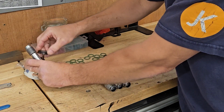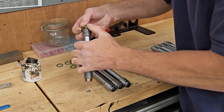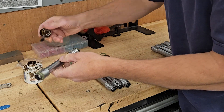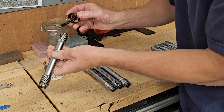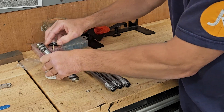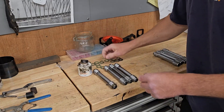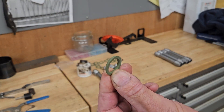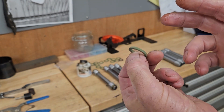First I'm going to apply a little bit of liquid seal around the push rod tubes just for a bit of insurance to make sure we're getting the best seal possible — over the top wherever there are sharp edges on the tubes. Then just the last bit of brushable sealer on the actual rubber rings on the seals and we're ready to assemble. These push rod tubes are actually shaped — they've got a chamfer that sits into the head and into the block, so make sure you get them around the right way.